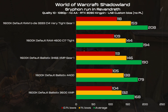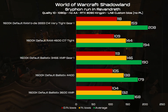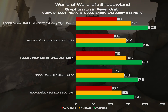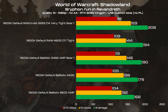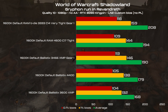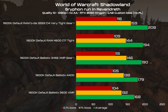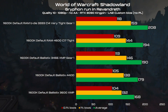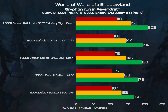And here's the chart you need to pay attention to. With the 11th generation, we now have a memory system very similar to Zen 2 and Zen 3, called Gear 1 and Gear 2. We can unlink the memory, and by doing so, we can reach even higher frequencies than the previous generation — running at 4600MHz was the limit with the 10600K. Now my limit is the RAM quality; this CPU can easily pass 5GHz on the memory with an expensive kit. But even so, going unlinked comes with a latency penalty that is hardly covered by the extra frequency. In fact, the lower speed of Gear 1 is still performing better than a very highly tuned Gear 2, which is great for the wallet — it means you can use a less expensive kit.